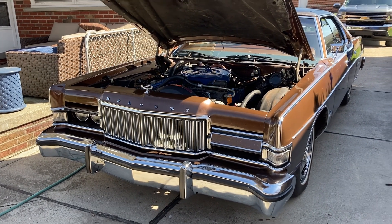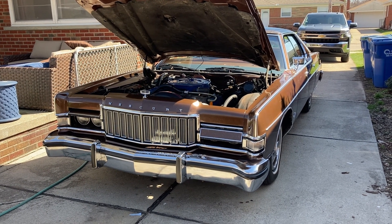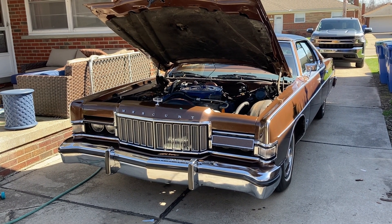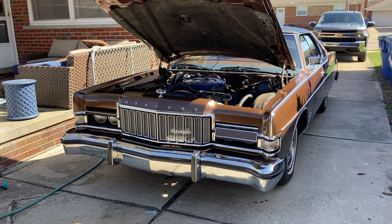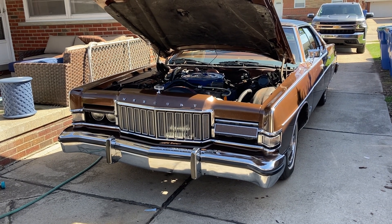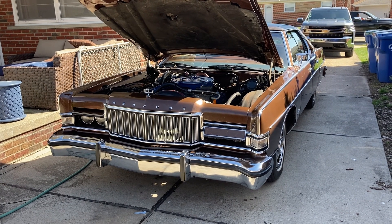This is not a car that sees salt — my other '74 was an Arkansas car that never saw any salt. It's just that the interior of the system gets moisture and corrodes them from the inside out. So I'm going to take these out and get them ready to be rebuilt or have some NOS ones put in. This applies to Lincoln and Mercury products — most from '73 through '78 have this dual actuator setup, which is more troublesome. My '71s and '72s, the headlight doors will stay closed for three months or longer. These were supposed to stay closed for several days, so if you see yours popping open after a couple of hours, they're going bad and don't have a whole lot of time left.